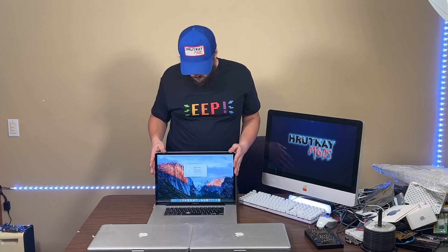Welcome back. This is now a fully functional system now that the dedicated graphics are disabled. It never had a Metal GPU to begin with, and the dedicated graphics — the HD 6000 series from ATI/AMD — ran really hot, liked to overheat, and was pretty slow. The chips would eventually literally melt, separate and fall apart, causing white screen and boot failure. Now it's running on HD 3000 Intel graphics, which aren't great, but will be plenty enough for what we need.